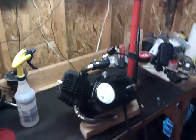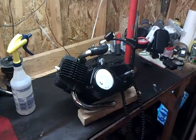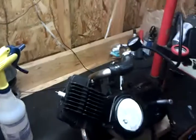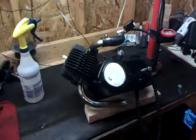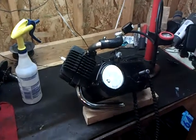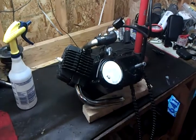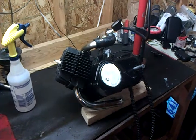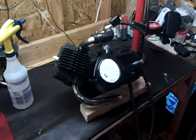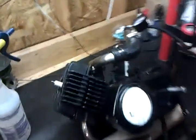I've been struggling chasing down an air leak on my Tomos A35 engine. I did the usual spraying around the intake with starting fluid and listening for the engine to rev up, but that didn't yield any results. It seemed like it's having trouble idling, I checked the timing, and it seems like it's running a little hotter than it should, so I'm thinking air leak — somewhere other than around my intake.